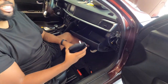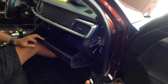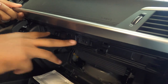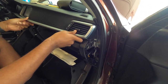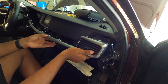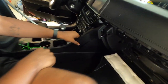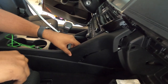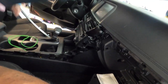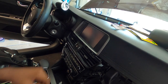So first thing we got to pay attention to is clips — these clips are very very tight so be careful when pulling them off. Pull off the panel on the side, you're gonna have one Phillips right there, and two more Phillips that you're gonna remove. Once those are done it's time to pull the clips. Pull with this part, this seems to be a little more sturdy. Once you get this off, be careful right here, this is very flimsy — you don't want to break it. Now you're gonna pull up this panel. Cool thing about it, you only have to do the passenger side. I started down here first and pulled it all the way off. It's gonna expose one, two, and three Phillips screws.